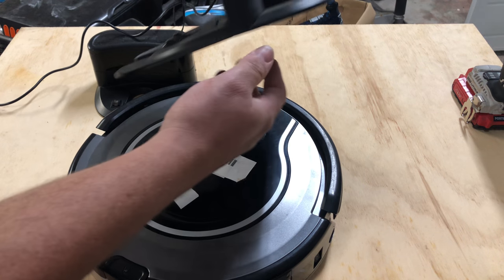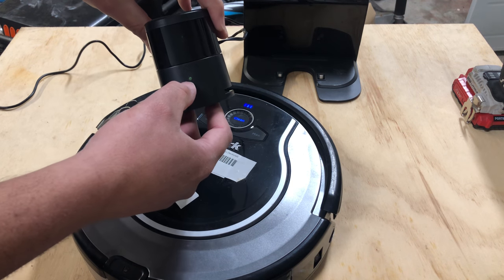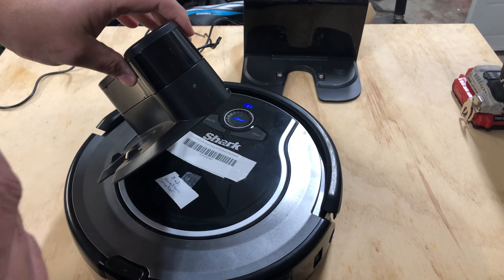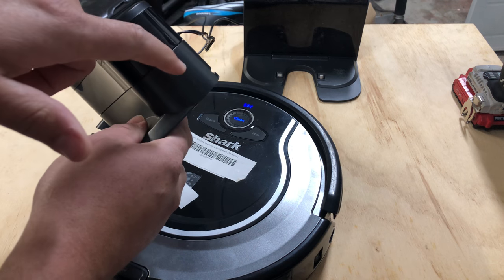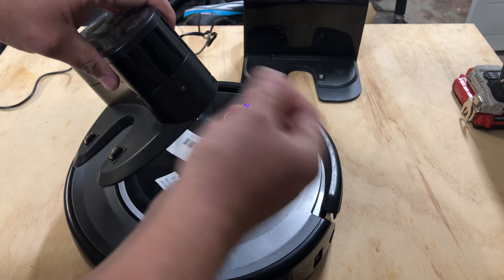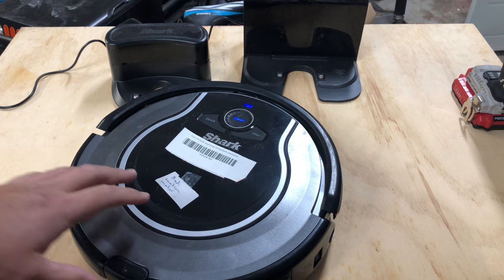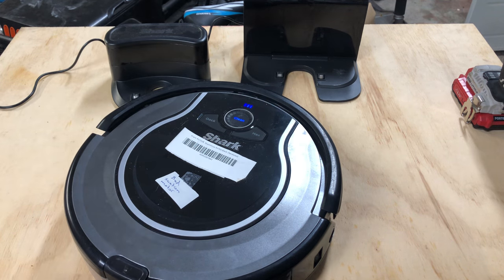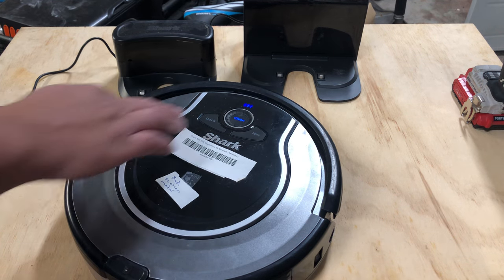On the right side there's going to be a little green LED on both of these. Now if you have a 700 series — which is a 725, 750, or 700 that has a yellow bottom — you're going to need the charger with a removable plug on the side. The plug will actually pop off, and those chargers have a different sensor in them that these will not detect, and those robots will not detect these.